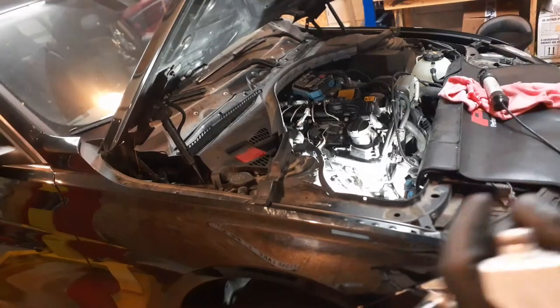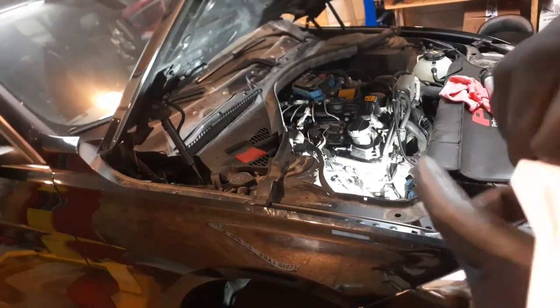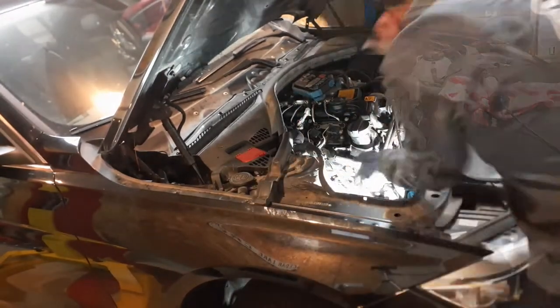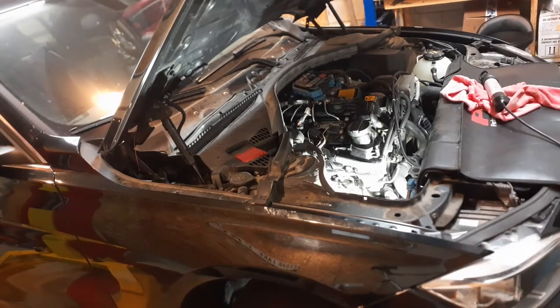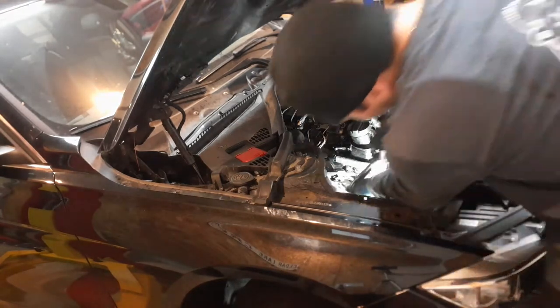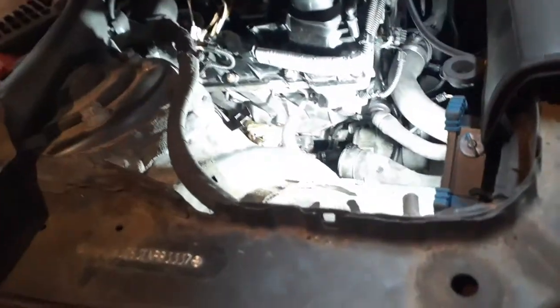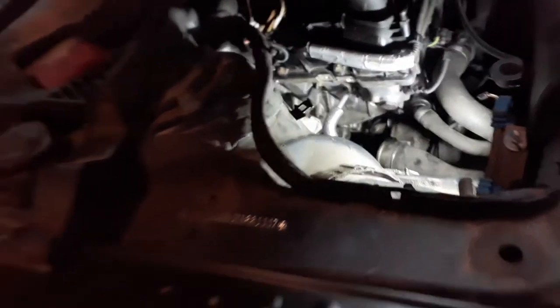All right guys, step one of putting everything back together now is reconnecting your coolant lines. So one of them goes there and one of them goes behind, right there, see there? So one and two. We're gonna reconnect those and it's 10 newton meters to tighten them. We're gonna lubricate the seal of our brand new turbo coolant pipe. Okay, so this one goes in like this. It is a T30 Torx. So let's tighten it up. Okay, 88 inch pounds. You can see down there, there's the line right there, and it's tightened to the block.